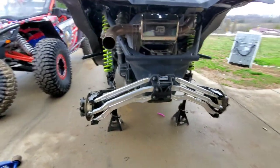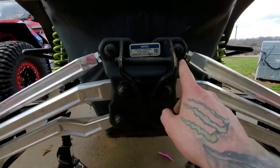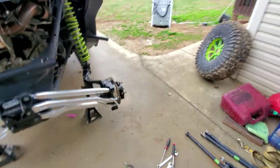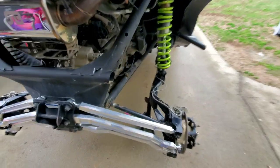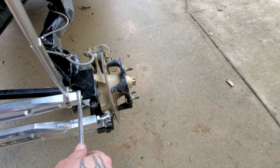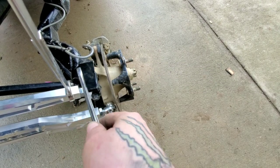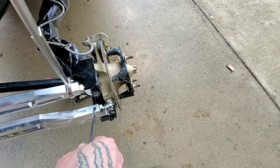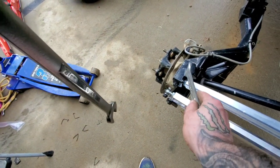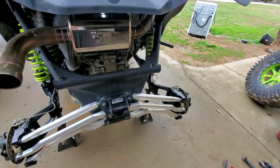Here's the finished product. I'm going to throw the wheels back on, torque those down, and check the air pressure. I've already tightened the three bolts on that side. One thing I don't like about heim joints — a 27-millimeter wrench fits perfectly to tighten that nut, and this one is a 24-millimeter. The problem is the top heim joint up here is really awkward to get to. The bottom ones are non-adjustable. We've got them all secured — ready to rock and roll.